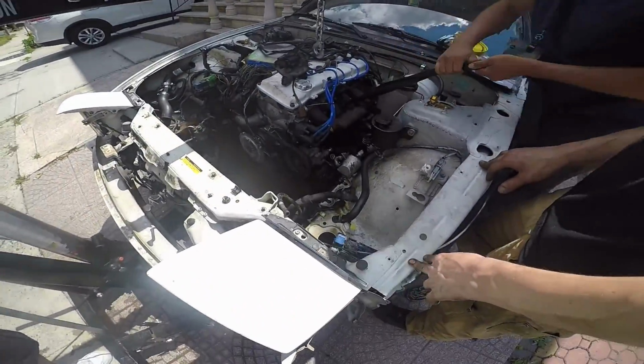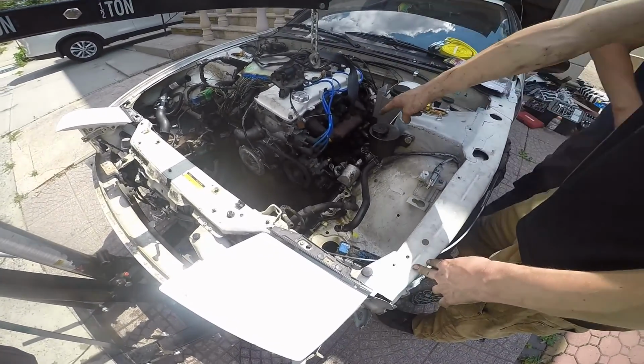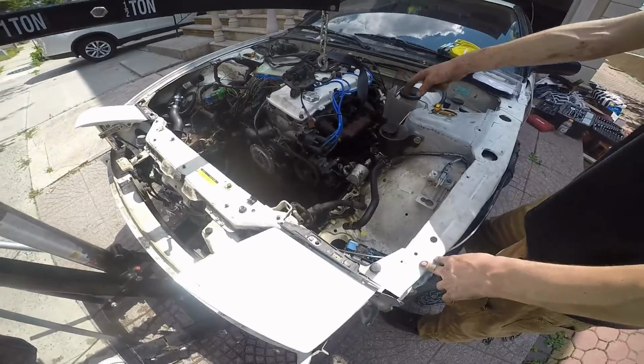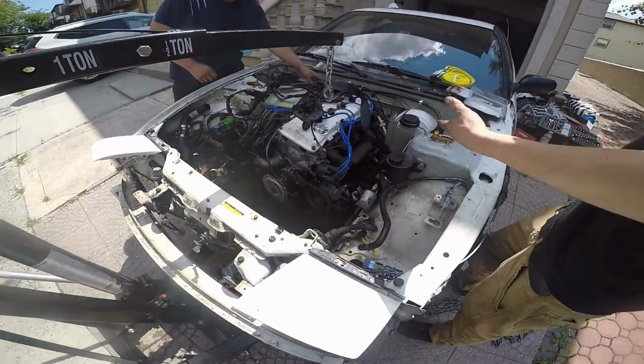That shouldn't tighten up? The bolt is not. You think it's gonna come loose? No, it'll loosen. That mount's not threaded, the bolt's just holding it. So if the bolt's off, the engine will lift right off of it. The screw doesn't have to be out, it'll fall out when we lift the engine up.